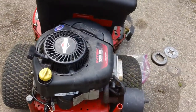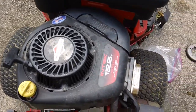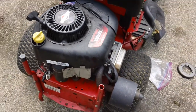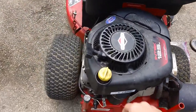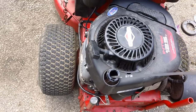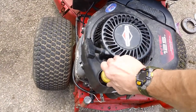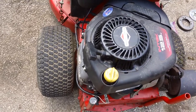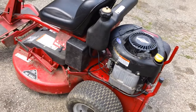We also installed a new air filter — the guy did not have any air filter in the machine at all. The spark plug needed to be replaced; it was totally black. And we did the oil change — the oil was completely black before, looked like it had never been changed in quite some time. Oil is perfectly good now.